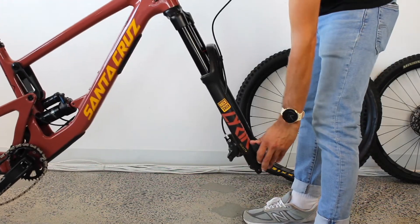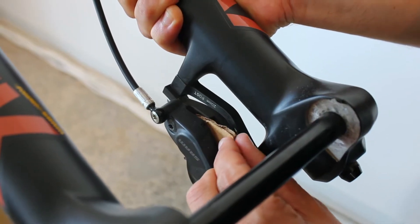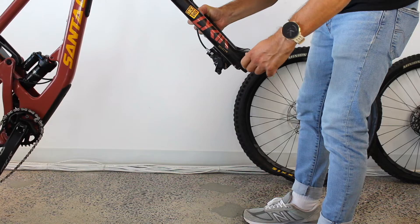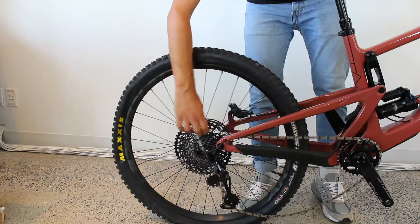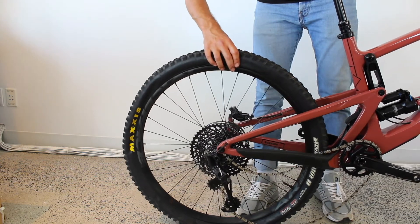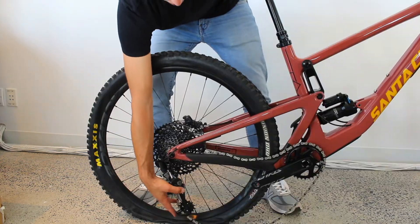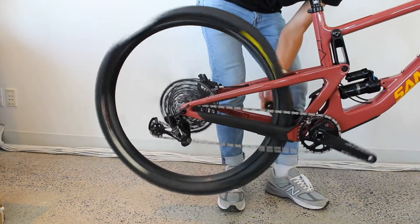You are now ready to mount your wheels. Let's start with the front one. Remove the shim from the caliper and through axle, then install the front wheel. Repeat these steps for the rear wheel, being careful to clear the derailleur and place the chain on a sprocket. Make sure the front and rear axles are tightened to the required specifications and give the wheel a turn to properly place the chain.